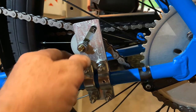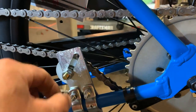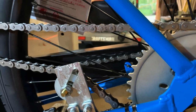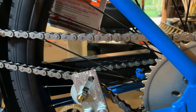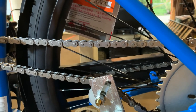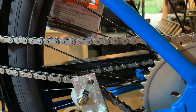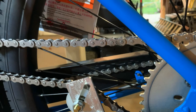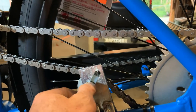Our chain tensioner — when you run the aluminum hub mount it's more of just a chain guide to refeed my chain back here. I shorten the chain with a chain breaker because they do send you a long chain. It's best to shorten it as short as you can possibly get it while still having a little play so it has room for adjustment, because it's going to stretch and limber up a little bit after a few rides.